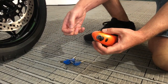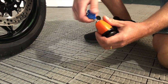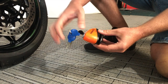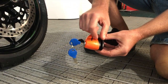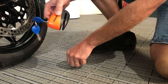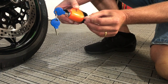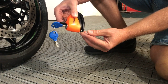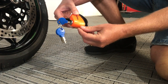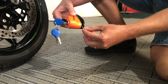To get to the battery, what you have to do is put the key in and open it up — basically by turning the key — and the shaft, the pin inside, will slide up making this section here clear. The reason you've got to do that is because the allen key to get into the thing has to go where the pin would be if it was set. So you pop the allen key in and you turn it anti-clockwise, and this will undo the little grub screw at the back.